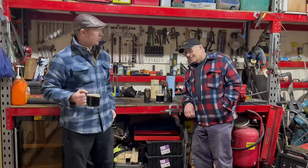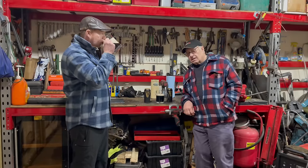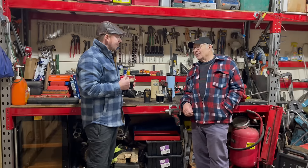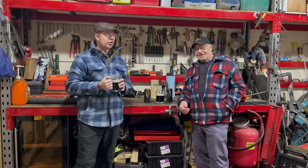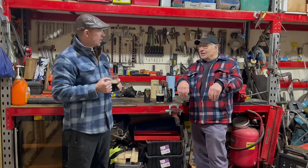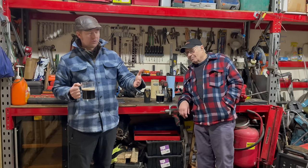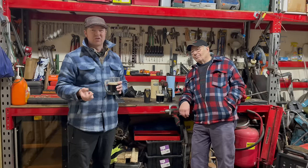The other thing's the choke, isn't it? We've got the choke to set up on it yet. The way we're using the choke at the moment is to just stick my hand over the air intake. Actually, we're just sticking it over the top of the front of the carburetors until we've got the air intake. Just covering the carbs up at the front and a bit of easy start gets it started. And it starts not too bad, to be honest.